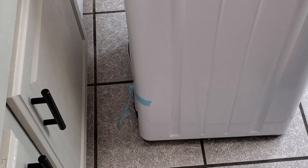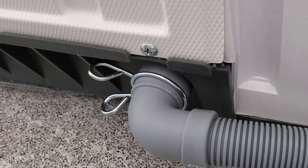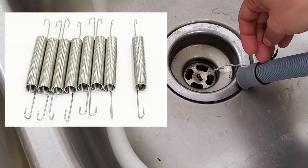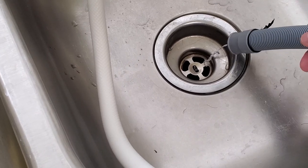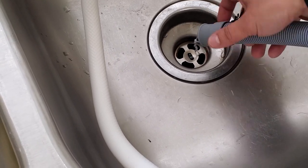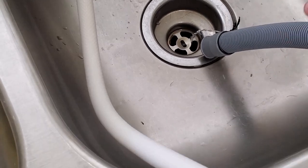Now the drain hose - I'll try to show you guys the best I can, it's kind of an awkward space and angle. We're going to slide it on in. I went ahead and slid that on in and put on the little clamp it came with. And then we connected the machine. I have two twisty ties, and at this end I would use a hook bungee to latch on and hold the drain in place so the water goes straight in. You just do it however you have to make it work - a string would even work. And at the end of the drain hose, I like to put a nylon over it and secure it with a rubber band so it acts as your filter, filtering out all the lint that comes through.